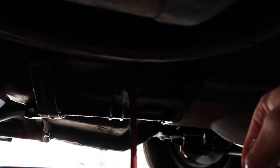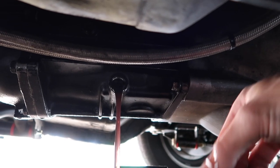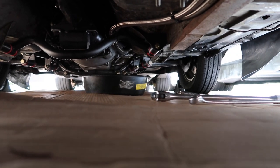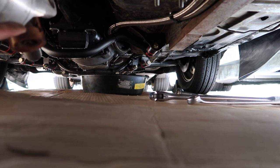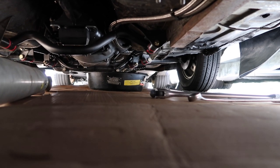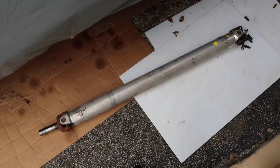We still had some fluid in there — that's surprising, I thought we lost all the fluid. Maybe we didn't damage this thing as bad as I thought. Got the four bolts from the driveshaft removed, so now we should be able to drop this guy out. Working with a limited amount of space here — slide her out of the trans nice and easy. There you have it, that's my driveshaft. Dumping the gear oil out — look at all those flakes of metal, guys. That is not a good sign at all.